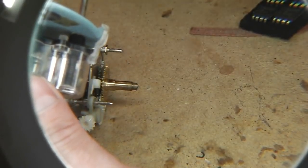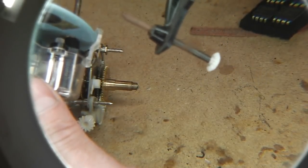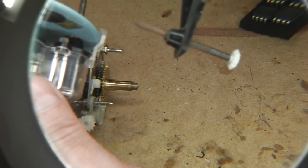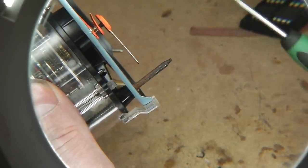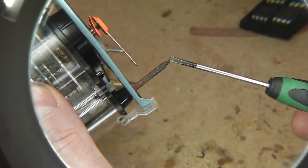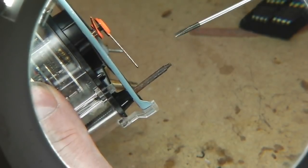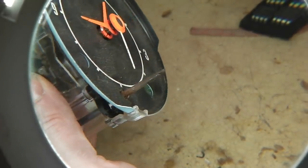And indeed on this you can see the broken shaft of the clock adjuster. At the end of that shaft, the sprung end's good and the little white wheel, but at the end there, where you would grab it with your fingers to adjust the time in the dashboard, they snap off, and this one is broke. So we need to find a clock that we can substitute in, because Bramble's is also snapped off, and you wouldn't be able to have your adjuster knob here to pull out and turn the time, because the threads have snapped. And that's a common problem. As you try and undo the screw which holds the knob on, inevitably the screw is seized onto these threads here and the knob just shears. And that's what's happened on this one too. I didn't do it, it was already broke when the car was found.